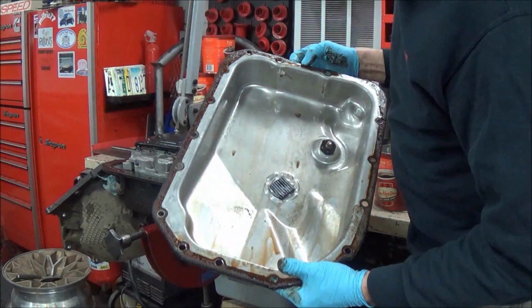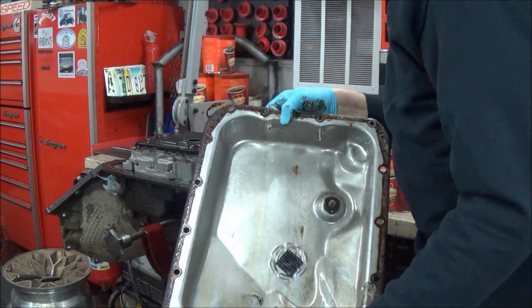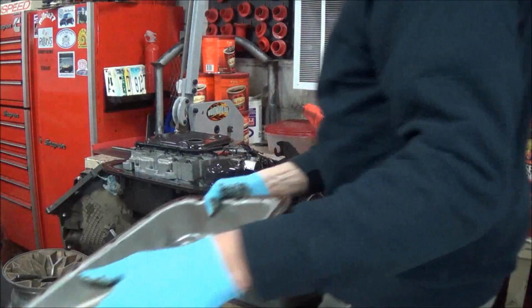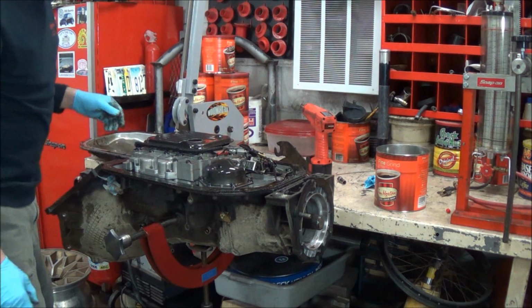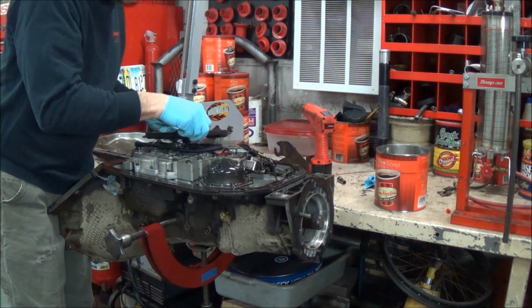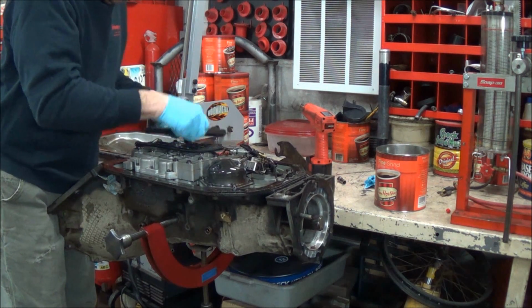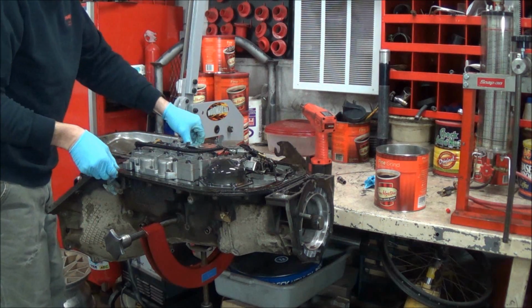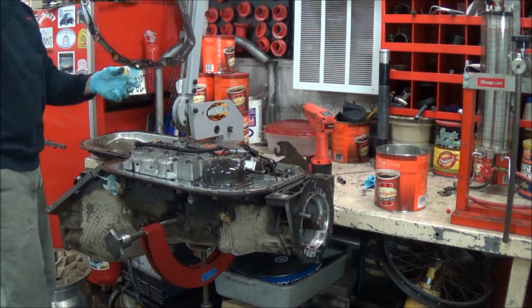That looks pretty good inside. There's obviously some metal filing here. I would assume that that's from the broken shaft. But Greg assumed that this thing was going to look like a scrapyard inside. Doesn't look that way. It's nice. So I'll get the filter off next. It just lifts out. Reusable oil pan gasket.